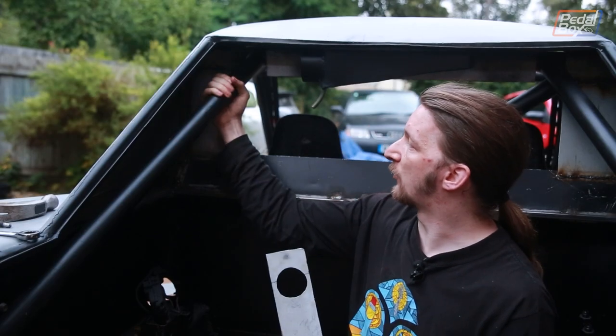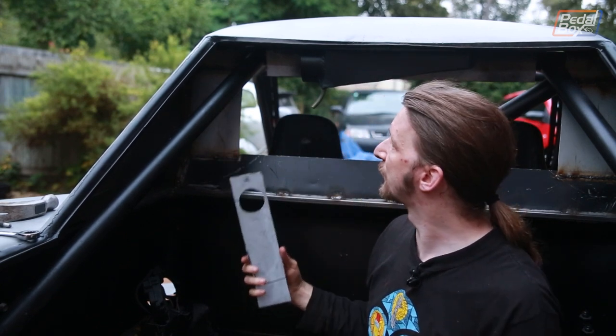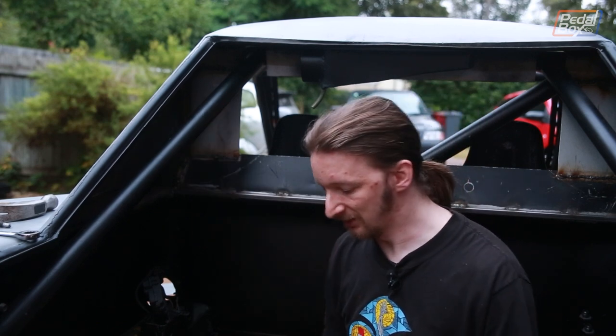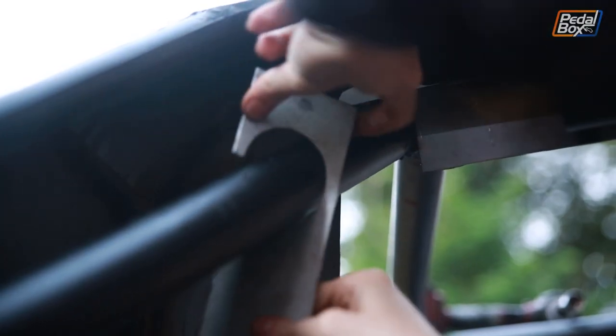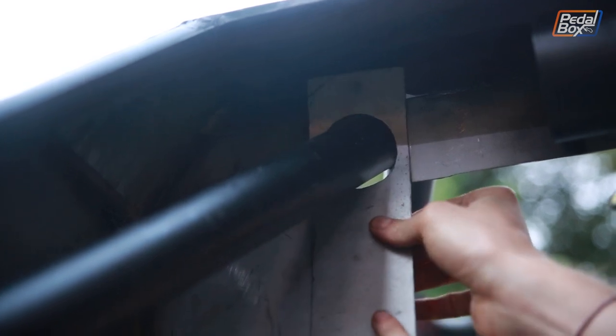Wade's been busy making up these little patch panels and these are going to go around our rear roll cage stays and just bring the panel inboard to about where the edge of our rear window is going to be. But how do you put a panel with a hole on it around a welded-in stay? The answer is a little bit cheaty - we've cut a slit on the side and we're just going to do that and hope that the metal bends around enough to clear the tube and then bends back without distorting too much.